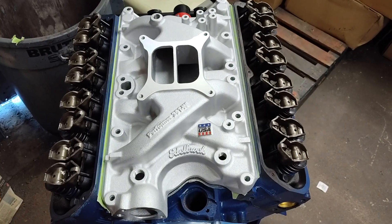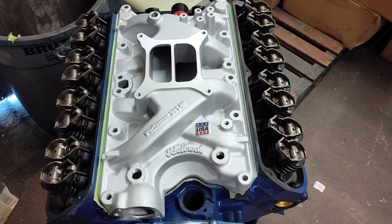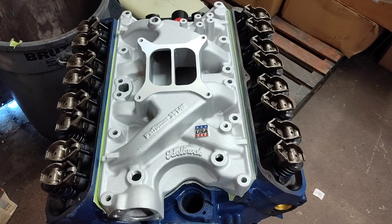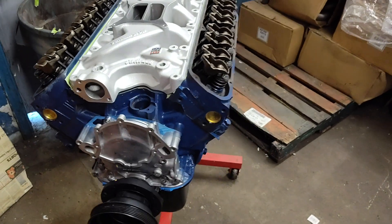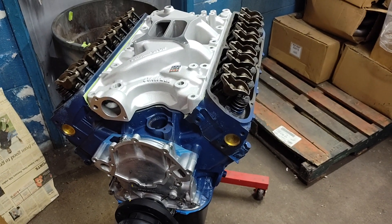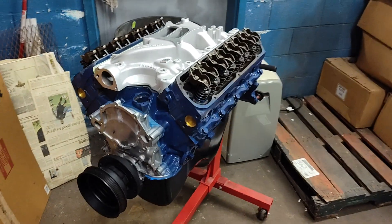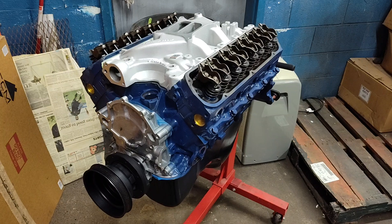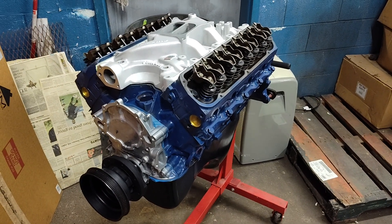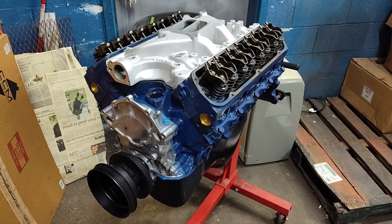Again, very conservative intake — remember, heavy van, heavy weight. It has a 3.08 gear in it; I'm probably going to stick a 3.55 gear in it. I have a factory high-stall torque converter to put behind it, which is like 1,900 rpm, that Mike Ivan at Top Line built for me. But this is pretty much the ideal daily driver 351. I'm usually a 302/5.0 guy, but these do make better truck engines — three and a half inch stroke gives you more potential for torque.